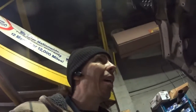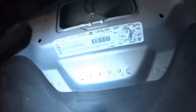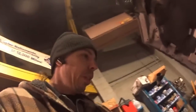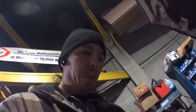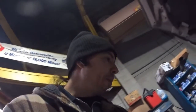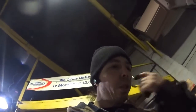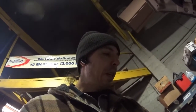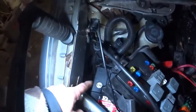Welcome back. We have a 2001 Pontiac Montana with a 3400. It was literally chain-dragged in from another shop. The original complaint is that it doesn't start — it cranks or clicks once like the starter is trying to engage, then nothing. Lights come on sometimes on the dash, sometimes they don't. The battery tested good but they put a new battery in, which I'm charging at the moment.